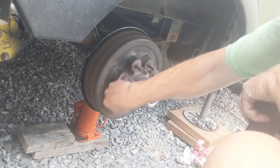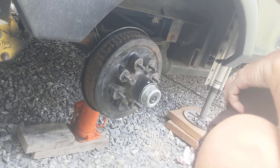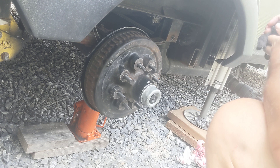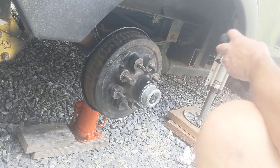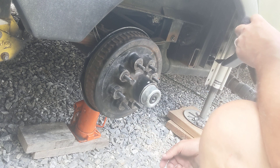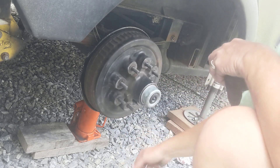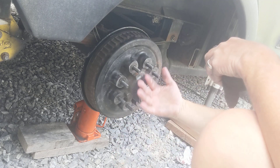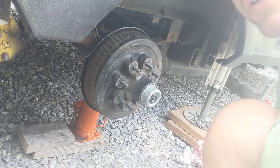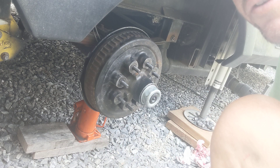The only thing left to do is adjust the brakes, put the tire back on, drop it down. You've just done the 12,000 miles service, replaced and hand packed all the bearings. These are easy lube — I did another video on how to do that; if you want to pump it full of grease you can. This one I hand packed. So if you blow out any seals, that's probably why — it will get on the back and all over the brake assembly. But there you go. Doesn't take that long after you've done it a couple times. Not too bad. Appreciate it.